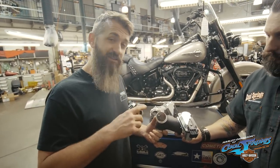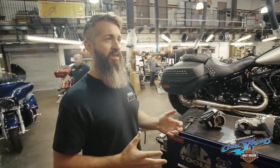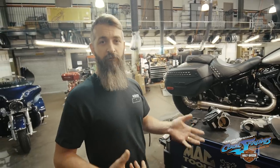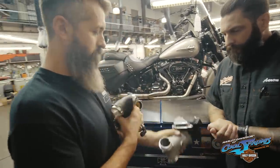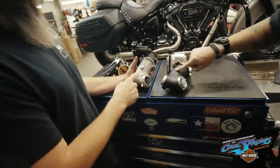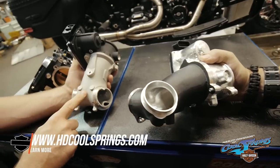We're doing this paired with an S&S 550 cam. It's pretty much a Screaming Eagle 117 motor build, high compression with an S&S cam chest, the S&S blue cam plate they just brought out, and a new oil pump in this build. We're expecting 140 horse — or depending on how it goes, 135 plus horse, or maybe 150. The main thing we're looking at between this throttle body and the larger intake is the plenum.